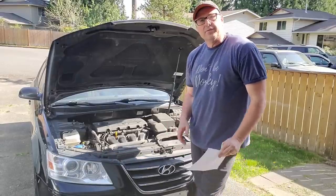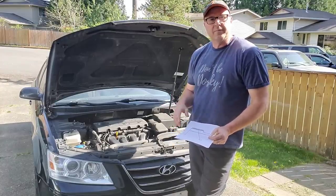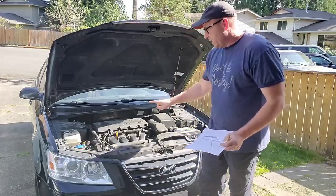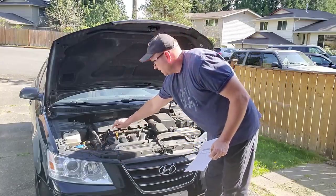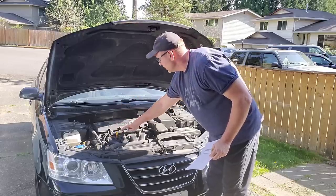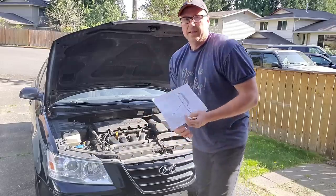I had a lot of requests for how to check your engine oil, so I'm going to show you how to do that. It's fairly easy, so don't be intimidated by it. You want to pop your hood and then locate this yellow handle — on my engine it's yellow. They've tried to standardize it in newer cars, but it might even say 'engine oil' on it, so just make sure you're checking the correct thing.